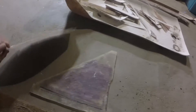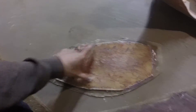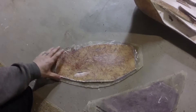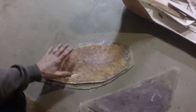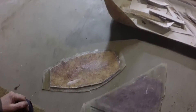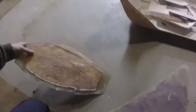This gives you kind of a base. I used an old bathtub out of an RV — nice thick fiberglass. If you get the flat sections of it, cut them out slightly smaller than this panel, and then fiberglass it on there. You put a piece of fiberglass mesh in between the two and a lot of resin, then a piece of plywood with a weight on top and a heat light on top of that — because it's winter time and it wouldn't dry without one. That gives this thin little panel some reinforcement so it's not going to bend or flex.